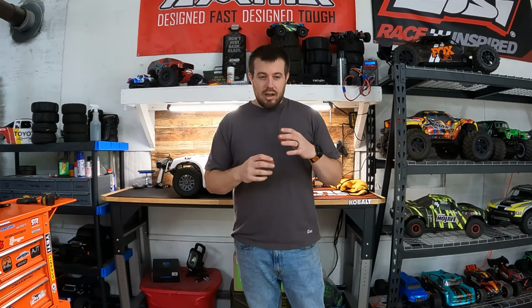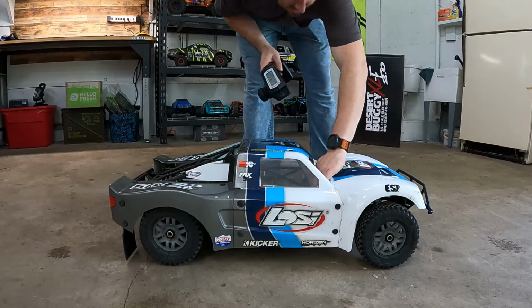Oh, and I also forgot, I added a new clutch. I upgraded from the stock clutch to one that claims it engages at around 8,500 RPM. I think there's a lot of give and take on that, so it's hard to really know when it actually does, but it definitely engages at a higher RPM than the stock one. And I'm just going with the whole beat and seat method on this. A lot of you, that might bother you. I don't know why it would, because this is mine. So yeah, all right, let's fire this thing up and have a blast.